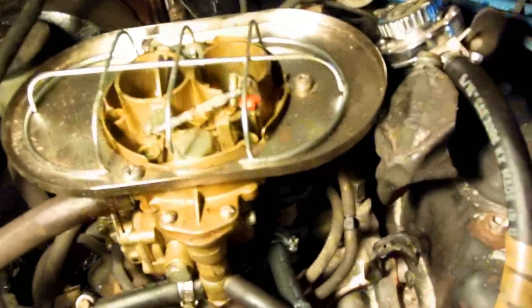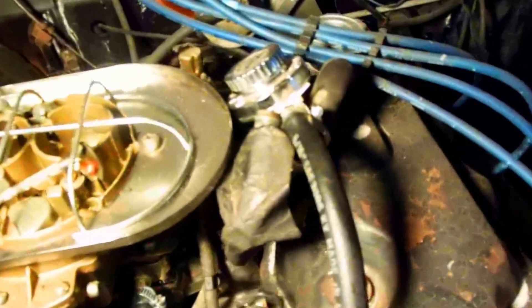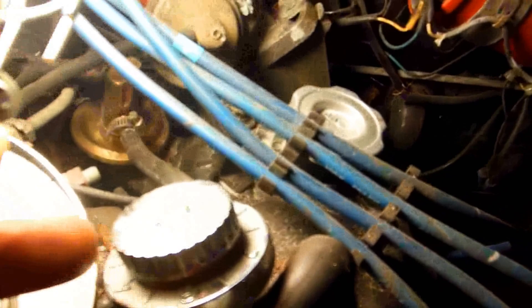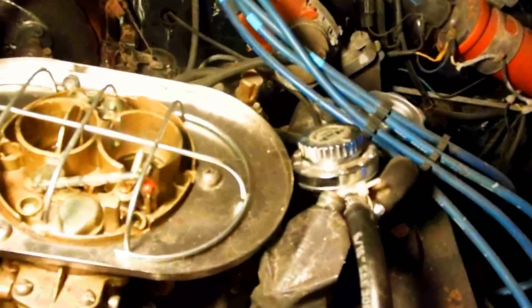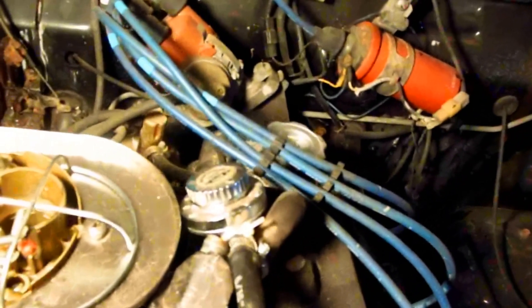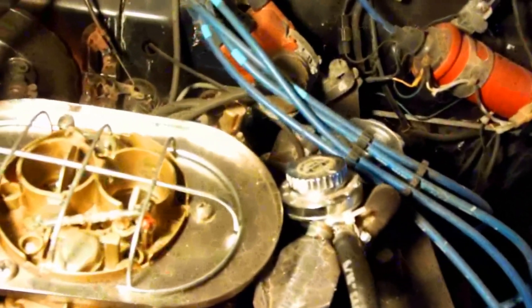In the meantime, I'm going to have to pull this out and drop the gas tank. But I wanted to point out that this fuel pressure regulator is a good thing because it's very easy to change your fuel pump pressure coming into the carb. When you're off-road, you want to bring it down about a pound less than when you're running on the road, and you won't have those problems where you're flooding out.